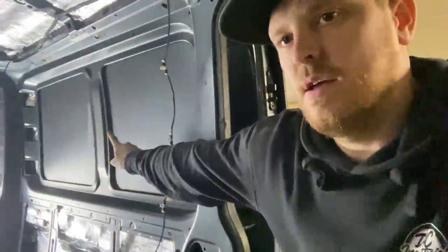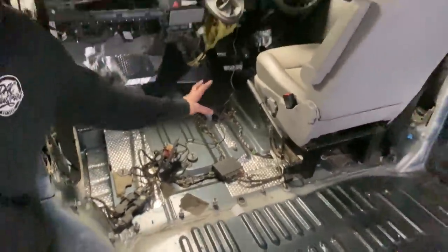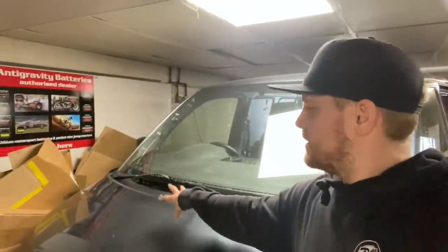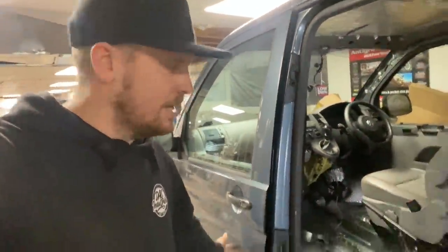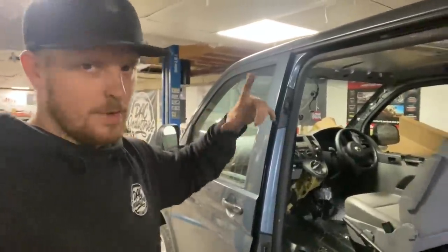That panel, that panel, and that panel in the sliding door — they're all being cut out for windows, which will possibly be the next episode. I've put a bit of sound deadening in the front on the step and on the floor where it didn't have any, just to help quieten it down. I've spoken to Mikey and Andy at Transport HQ and with the 2.5 one of the best things you can do is take the scuttle area out, take the wiper motor out, and sound deaden the bulkhead. Apparently it makes a massive difference so we'll probably be doing that. I haven't done anything with the front doors because I might have had a phone call about some exciting stuff for the cab which will come in a future episode.